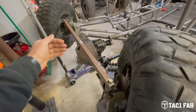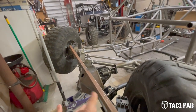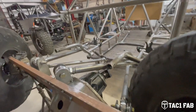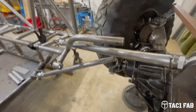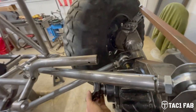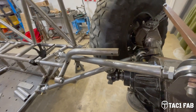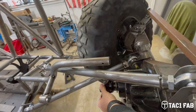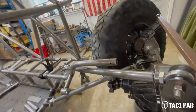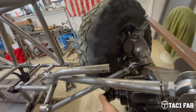We're going to internally limit the steering ram so I've only got about 45 degrees or so, because I want to make sure the U-joints in the axle shafts are happy. The other thing we figured out is that we're going to have to raise these upper link mounts a little bit because we have interference and a clearance issue with this yoke on the high pinion. It's hitting the upper link. This is a 1410 yoke and I'm not planning on running a 1410 U-joint — I'm planning on running a 1350, which is smaller. However, if I can make sure it'll clear the 1410, then we know we've got plenty of clearance. And if in the future I should decide to run a 1410 yoke, it's already there.